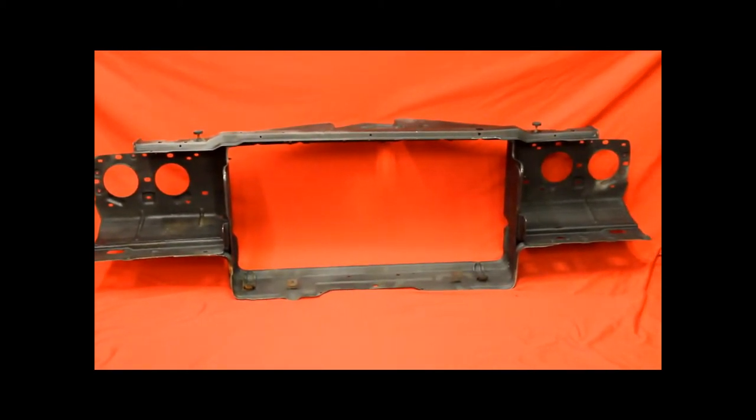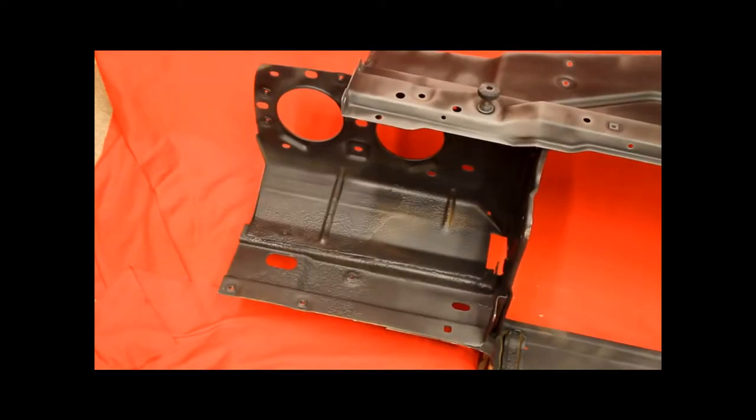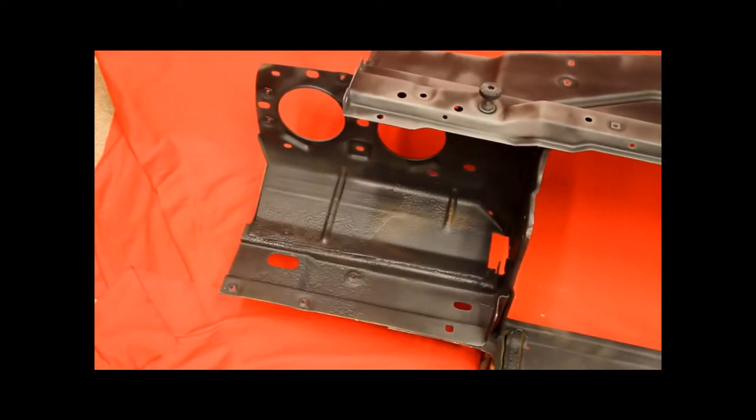See the ripples on the left there? I'm going to show you a close-up of it. What we've done here is we've shot a lot of primer, filler, and Z-Chrome in here because it had a little bit of pinning.